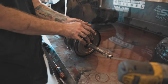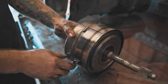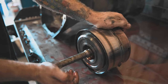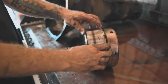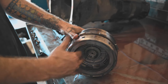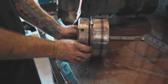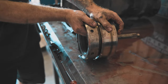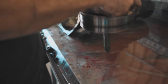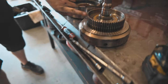Here's your problem. It feels like the direct clutches are welded together. But this drum is splined to the clutches inside here. So your input drum - this is called your forward clutch. This clutch is on all four gears. It has big teeth on the inside that go into the direct drum. And the clutches in there feel like they're welded because it should just slip out. There you go. Nice. See? So they get stuck on there.